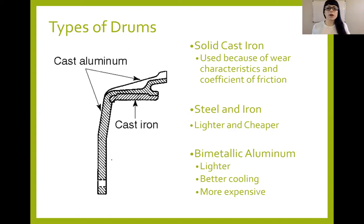A lot of you may have questions: how come drum brakes have been around this long and we haven't seen any performance-style drum brake? That's because it's a drum brake. If you want serious, steady, consistent performance with less fade, you're going to convert to a disc brake design. Most companies have made it so easy that there's really no point to buying performance drums, because the amount of money you'd spend you could have just converted to disc. The bimetallic aluminum is your best bet for performance on a drum, but manufacturers aren't going that route — they're just doing disc brake designs on their more sporty vehicles.